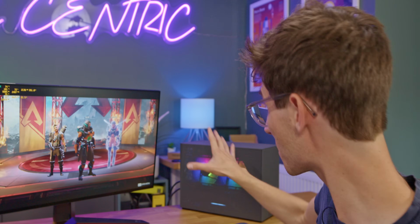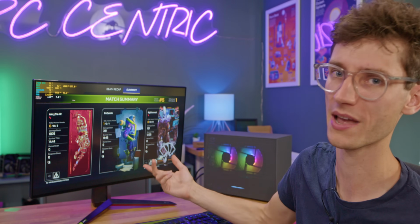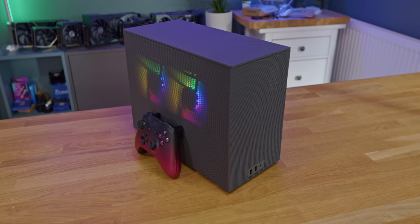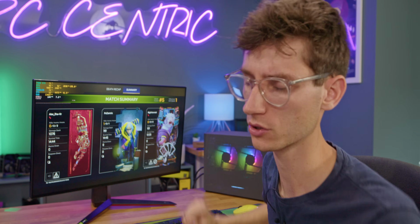But having said that, there is a big advantage of going for this, or two main advantages really, mainly in that you don't have to use a PCI riser cable, and that does have two advantages. First one is price. This comes in at $110. That's quite a lot less than the Meshroom S if you don't already have a riser cable you want to use. And obviously the benefit of not having to use a riser is the fact that if you are going to go for a PCI Gen 5 board, then you can use that natively. You've not got to worry about upgrading that in the future as well. Everything is just sort of drop in and ready to go.